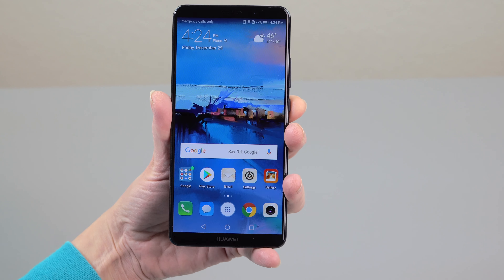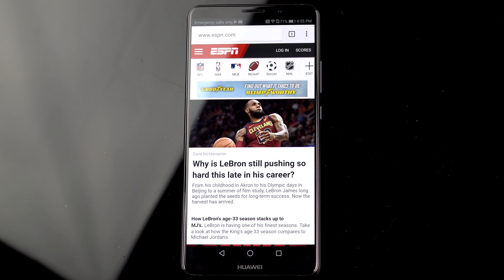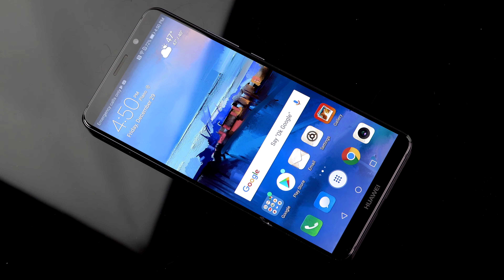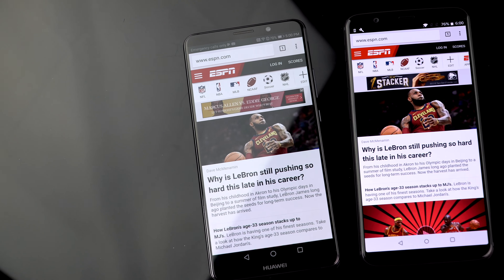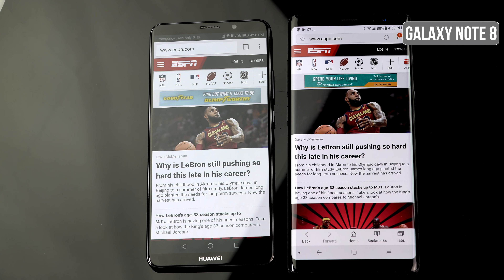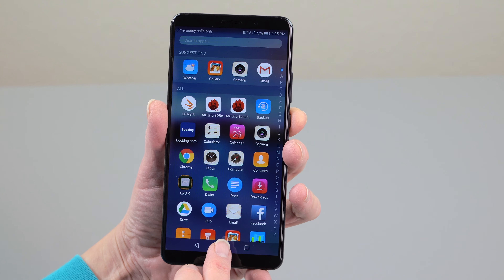Undeniably this is a nice-looking phone. You've got an OLED display here, it's six inches. The resolution isn't super high, which is surprising — it is Full HD but taller, so it's 2160 by 1080, the same resolution we saw on the more affordable OnePlus 5T. It's lower than the Samsung Galaxy Note 8 resolution, but at 402 PPI that's still very high pixel density — you're not going to look at it and say 'what jaggies?'